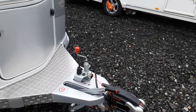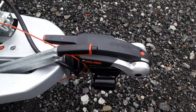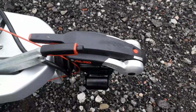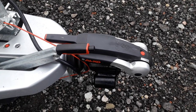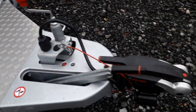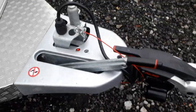We'll start with the hitch. This is where the ball joint goes underneath. What we tend to do is back up the vehicle towards the hitch, check the height, wind the jockey wheel, and bring it up to a level where we can get the vehicle under, then lower the jockey wheel — you'll know when it's connected by a clunk. One thing I was always worried about when I first started touring was whether I'd hitched properly. While the jockey wheel is still down you can wind the lever back up and check that it lifts the vehicle — then you know you're connected properly. This is an anti-snake device. The ball on the vehicle must be kept dry and clean but slightly scuffed — whatever you do, don't be greasing it.